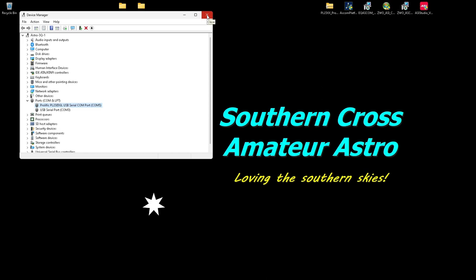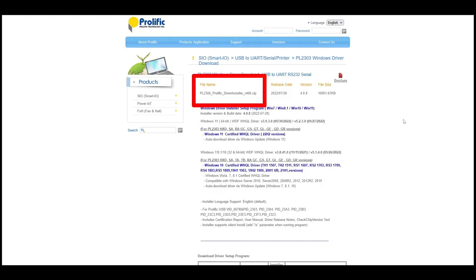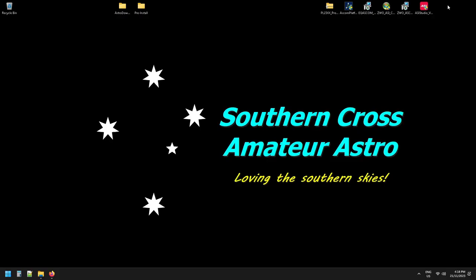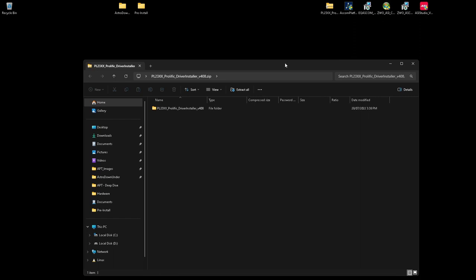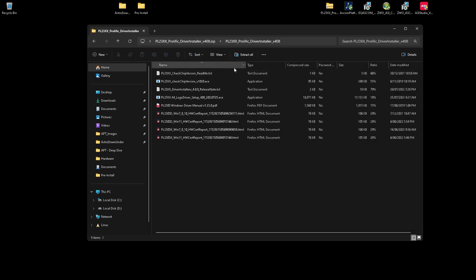So if you haven't got one here, simply follow the link in the description and it'll take you to the Prolific website, where you'll find the Prolific installer here. So download that, and then once you've got that downloaded, browse to where it is on your desktop or in your downloads. I've got it on the desktop here. I won't be installing it, of course, but simply double click on the zip file and it opens up this. Go into the directory, and what you're looking for is the setup, this one here, and all you do is run the setup and that will install the driver for you.